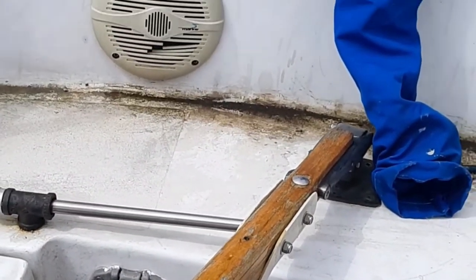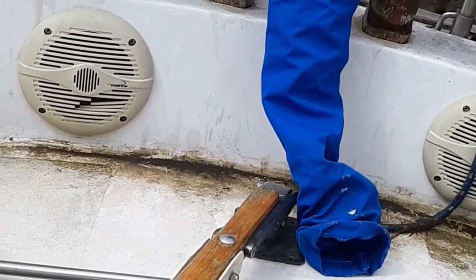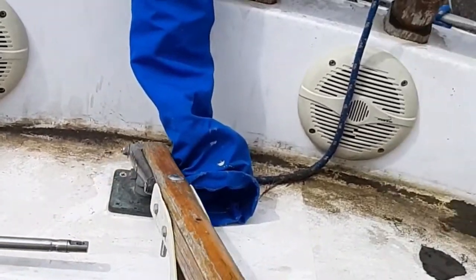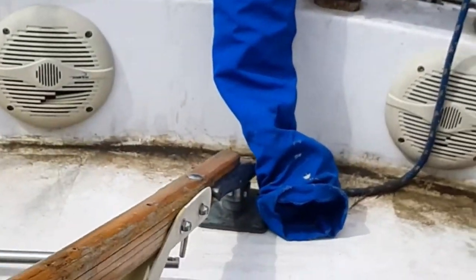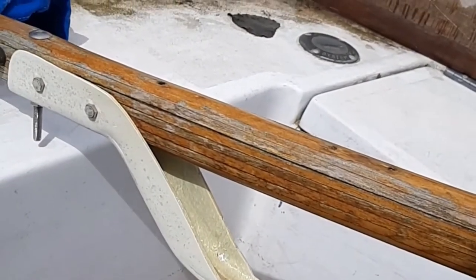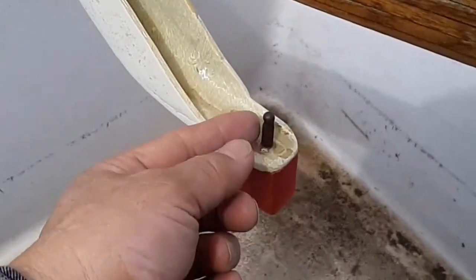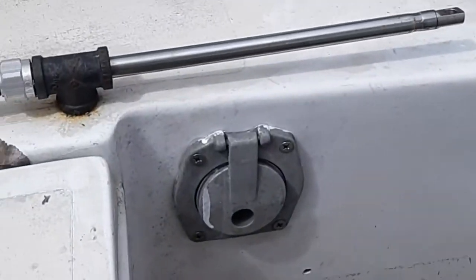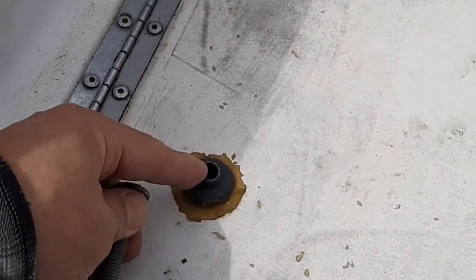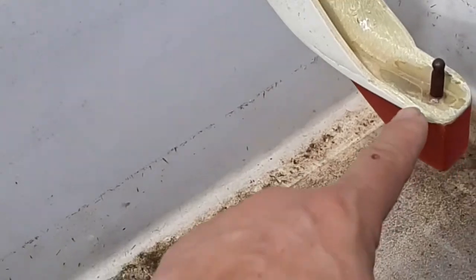And when we need the tiller, especially for entering the harbor, I use the tiller rather than the wheel, because with a tiller, we can turn the rudder very quickly. And also, we can row the boat with the rudder like this. And also, we have a tiller autopilot. I didn't bring it here, but I took a picture this morning and I uploaded it already. This key is for the autopilot. So the autopilot base sits right here. To this hole, we put the tiller base, and another end goes to here.